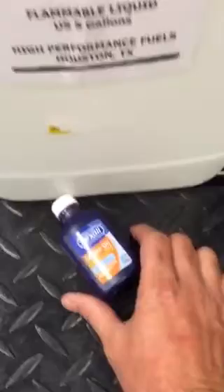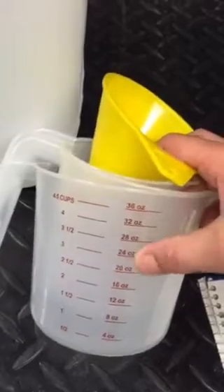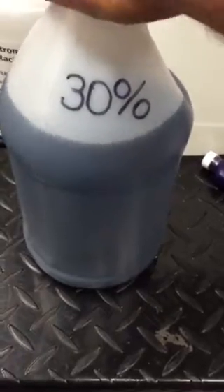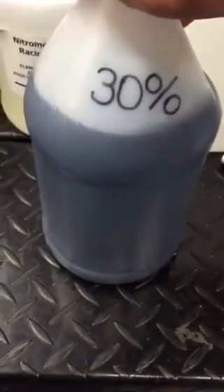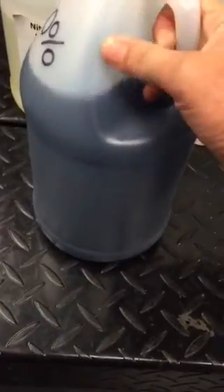I picked up a couple of measuring cups — I paid $5 for three of them. Just make sure they read ounces, because that's what you need to mix up a gallon of RC fuel. I already had a funnel at the house to make less of a mess. Once you're done mixing everything together, you'll end up with homebrew. I dye mine so I know what percentage of nitro is in there — this is 30%, and I wrote it on there so everybody would know.